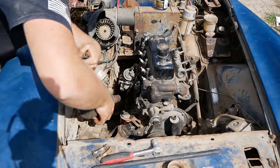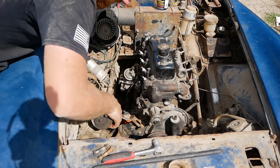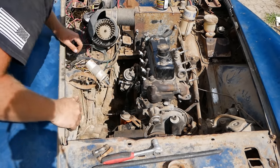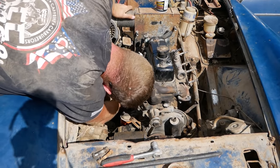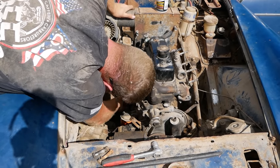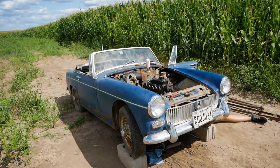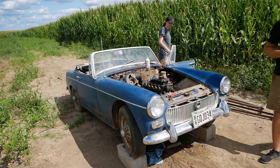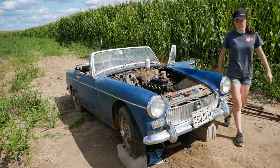She was right. Time to start putting some accessories on, such as the starter. No, wait, I forgot to prime the clutch. And if I put the starter on, I can't prime the clutch. So it's time to prime the clutch. Yeah, I think we're good. Does it feel like there's a clutch there? Yeah. That's open now. All right, let off. Do it again. All right, we have a clutch. Let's get a starter in it. That car's heckin' small. I don't know why y'all think I like it. I don't.